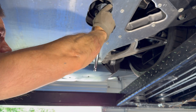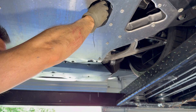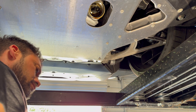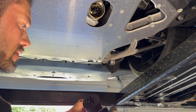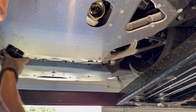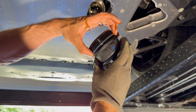If you have one of these, you need to get one of those oil catch things to catch the oil. Okay, here we go — about to get ugly. This just pops off and locks onto the back side of the canister. As you can see, you've got your O-ring — that's going to have to come off and a new one goes on. What's interesting is it sits one rib from the top, not all the way up like you'd think. It sits right here.